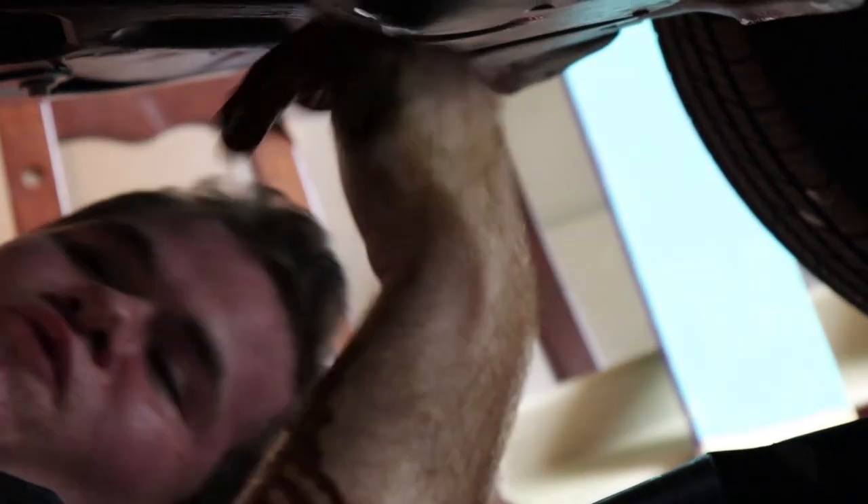There's the oil filter. Whenever you take your new oil filter, you want to get some of the oil onto your finger and rub it around the gasket. You want to lubricate the gasket so that it doesn't stick to where the filter goes. Then it just goes right back up in there and screws on. When you put it on, put it on tight but not too tight and don't use a tool to put it on — you could damage the filter or put it on too tightly, and that will give you a bad day because you'll have to change it again and it may not filter properly.